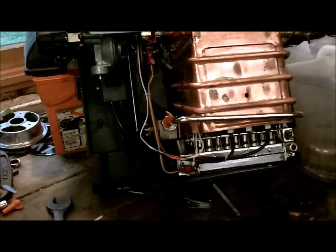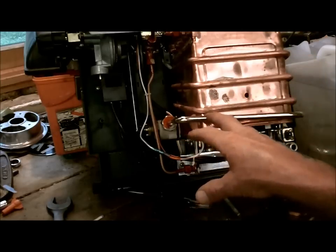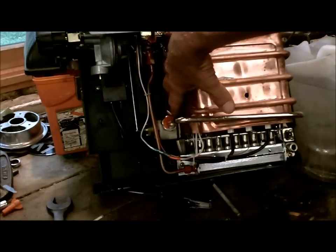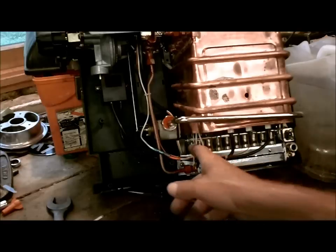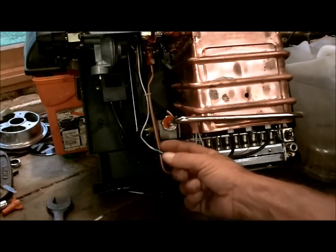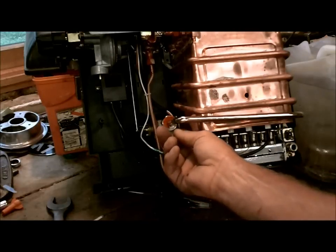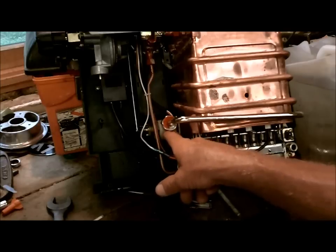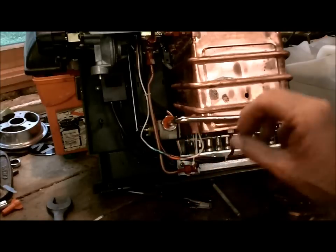So I know if you're like me, you've gone on and searched for 'Coleman hot water on-demand heater will not heat,' 'starts and shuts off,' whatever it is — it's a simple fix. You don't even have to bother with these wires going in. There are four screws on here where you can take that top off — don't even bother. If you take that top off, you still can't see the impeller. All that's doing is telling it that there's water, so you can leave that on. All you've got to do is blow air through there — a lot of it — so it really frees it up and it'll work like a charm.